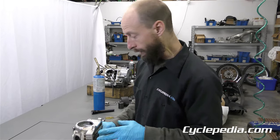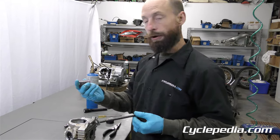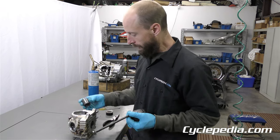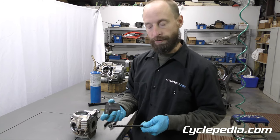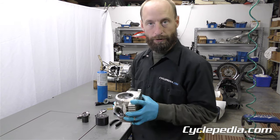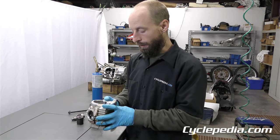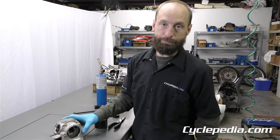I'm pretty sure I've read that they come out through the inspection hole, and maybe that's why you want your camshaft out first. So that's pretty much the process. To get the other side out, same thing — we're going to thread our tool in. To recap: we made our slide hammer using a socket. Some of these are way more difficult than others, so find something with a little more weight to it. Just be aware that you don't sling your tool or drop your cylinder head and damage it. Go slow and take your time — it is possible. That pretty much concludes that procedure. We'll go on and disassemble the rest of this engine.